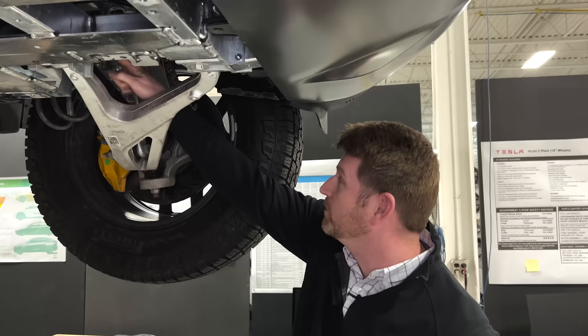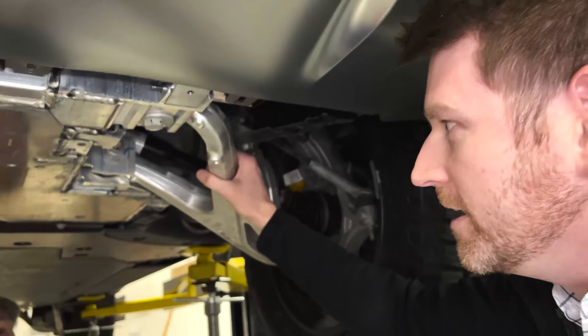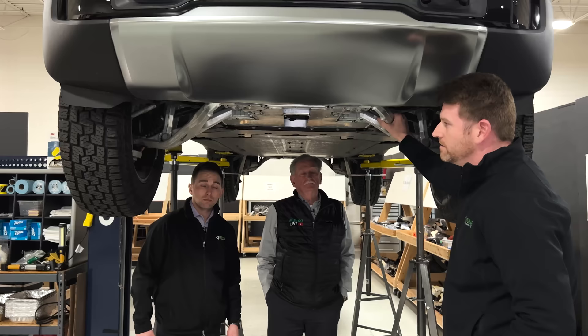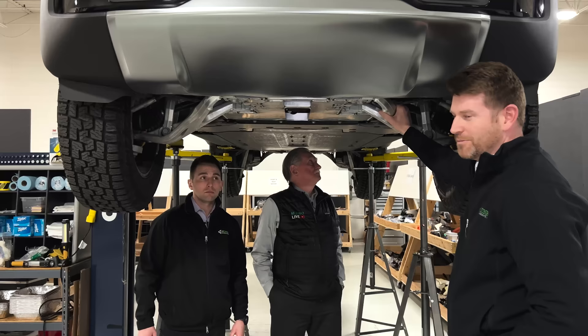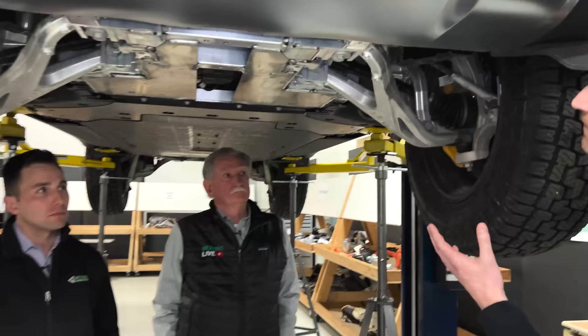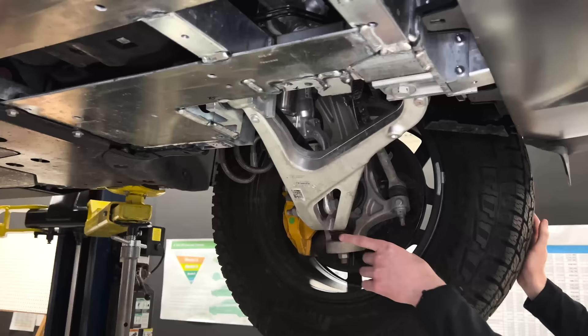The CVs come into the top of the hub, and then it's essentially a set of planetary gears that drive the wheels. When you look at the ground clearance — comparing a Humvee to this — it's very similar in terms of the overall profile of how flat the bottom of the vehicle is. That's a vehicle packaged around mobility, not necessarily creature comfort, but this is probably the only thing I've ever seen with a similar flat-bottom profile, especially with how much down travel the rear has.